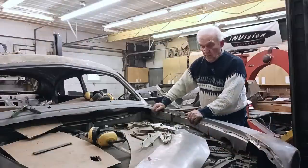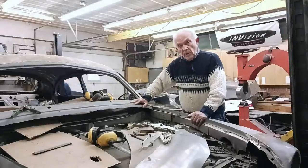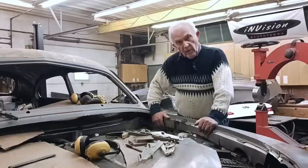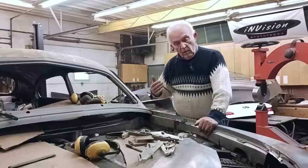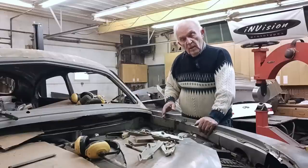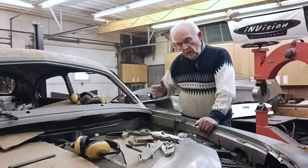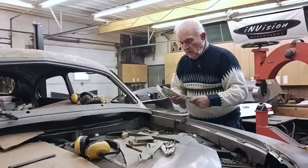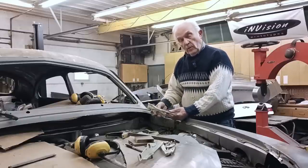We're taking a break from the trunk back hinges and going to start on the hinges for the front hood. We have to establish a solid mounting place on the structural part of the body such that the line of the hinge is perpendicular to the pivot. So we took off the shelf a set of hinges that will basically give us the up-and-out motion that we need.